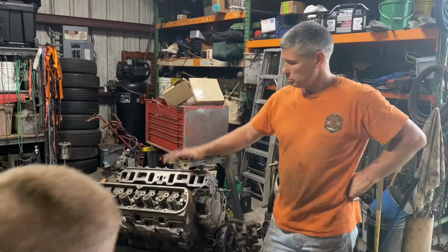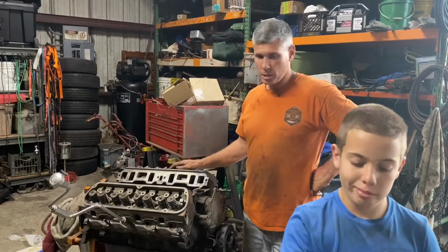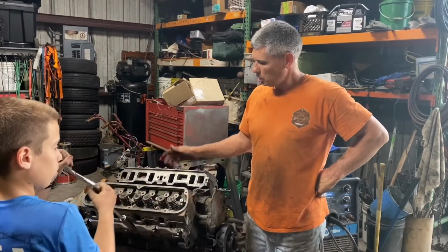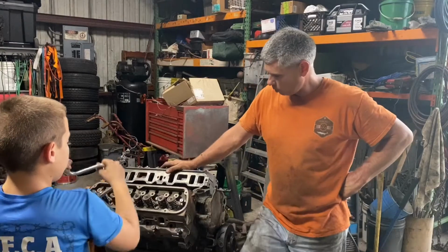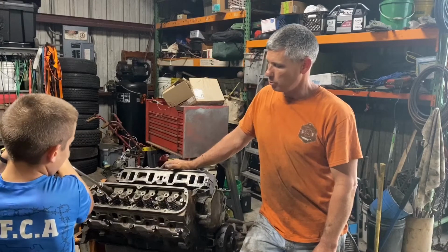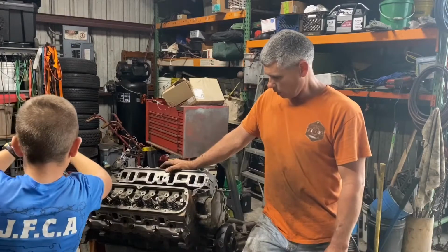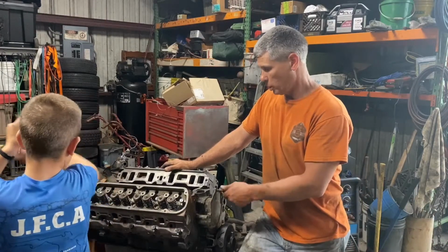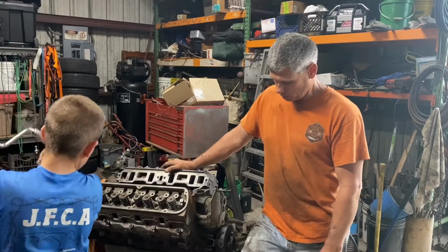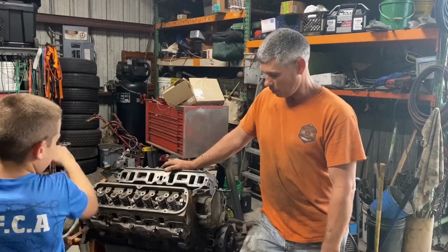Okay, so we didn't get the camera on because I'm an idiot. So we got this head first step torqued down 55 to 62. We do it to 60, and then Stevie's going to finish torquing it. He torqued that. Then we're gonna do this one. It doesn't much matter. So let him spin them. He's spinning them down with a speed wrench. And I mean, this is a super budget build. This is just parts I had laying around, and everything is used.